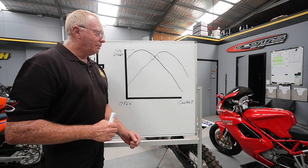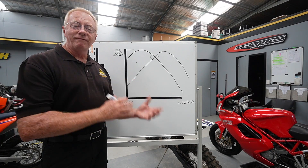In this particular case with the new EXC shock absorber, we have the basics of a rebound separation valve, but the values are completely wrong. It has all the makings of a decent rebound separation valve, but it needs to be addressed with a little more understanding. With the bleed that we have, we want to make it a little larger so we get the compression effect we require, and the fact that the valving is locked down on that separation valve means we're getting additional rebound damping that we don't want. Our adjustments allow us to get the compression effect we want and to lift that valving off its seat so we don't get additional rebound damping from the separation valve. There's already enough rebound damping in the shock absorber — in fact too much — and by making these modifications we get a lot more grip, comfort, and control.